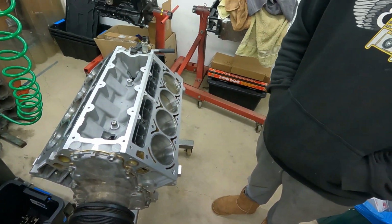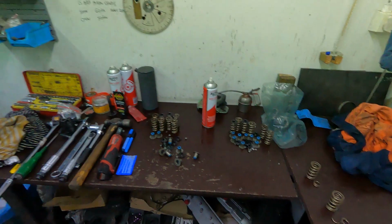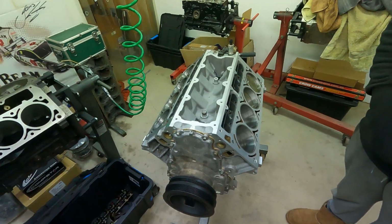They showed no evidence of detonation or no evidence of it being unhappy at all. So, I don't really believe in coincidences of that nature. We've got 2 broken springs and 2 broken upset cylinders, so it's a bit of a stretch.